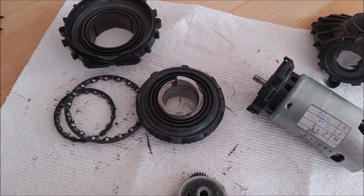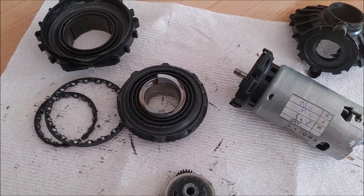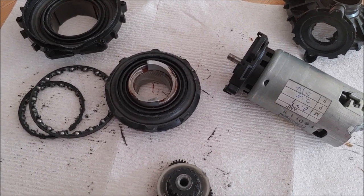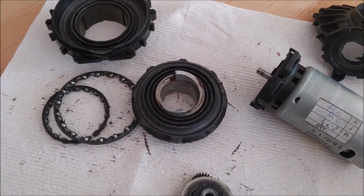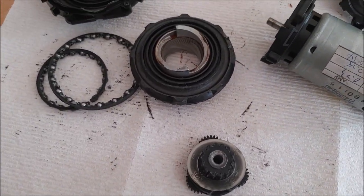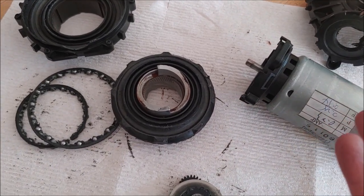I'm doing about three to four shots of espresso five or six days per week — a very low duty cycle, certainly far less than the 10% duty Baratza recommends for this grinder type. So lasting a year and a half to close to two years before the gearbox inevitably gives out — I honestly don't foresee how this won't happen with literally everybody's grinder if they're using it for espresso. It's just a fact of the physics and materials involved.